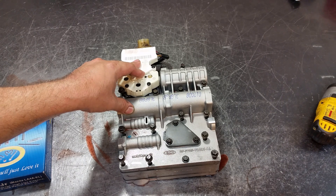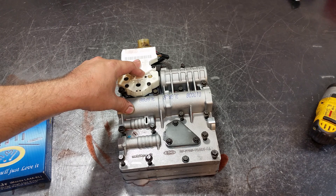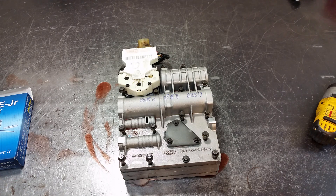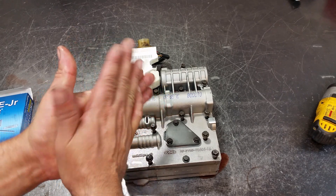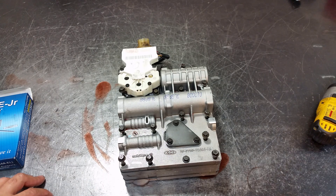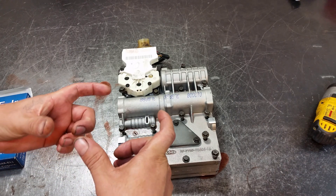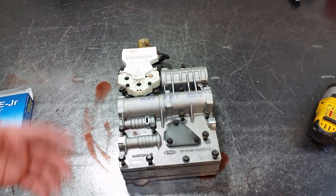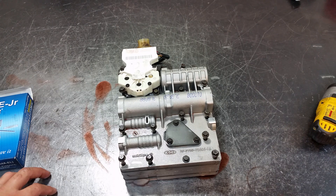The main issue with this valve body is cross-leaking between the torque converter clutch circuit and the line pressure circuit. What that causes is broken bands and also the forward drum — it'll break the forward drum where the snap ring goes and just pop it out. That's the main issue. Also, durability of the friction materials: too much high pressure kind of scrapes off the friction off the forward clutch. Sometimes you see the forward clutch drum isn't exploded yet but the frictions are real worn out, and you may encounter a broken band.